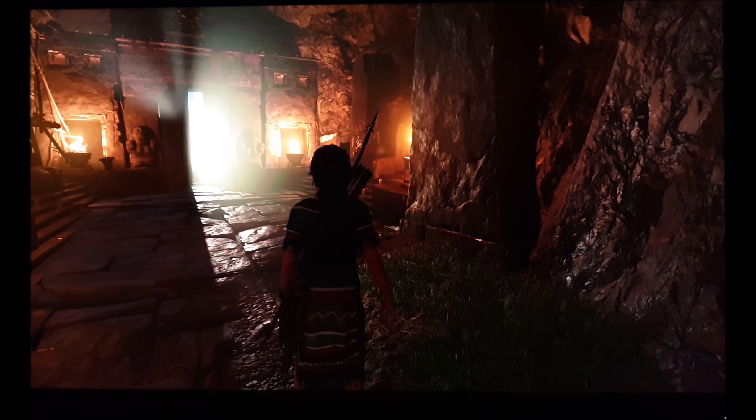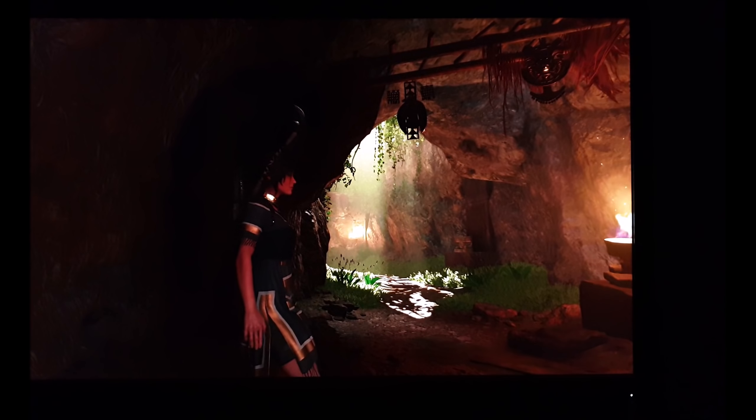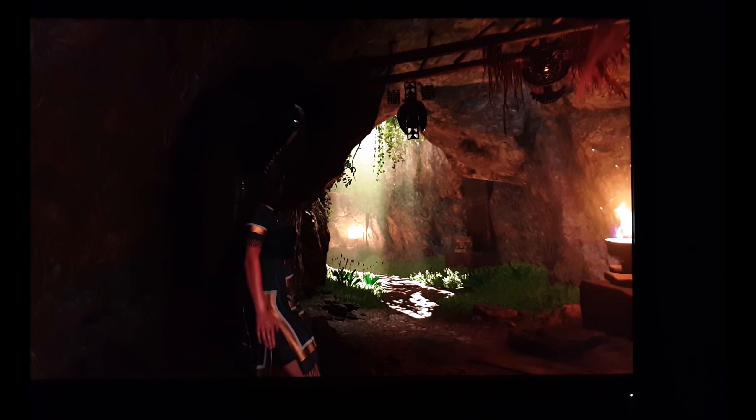If you view those elements towards the edge of the screen, or shift your position to look from an off-angle or more extreme angle, you can kind of see the detail levels change. Being a VA panel, it does have a bit of VA glow — most noticeable towards the corners of the screen — but there's actually a very small amount of that on this model. Even in much darker scenes you can kind of see it if you're sitting in a dark room, but it's not extreme. Comparing it to IPS glow, it's really very subtle. I've certainly seen more of this on some VA models of this kind of size, particularly the curved models. So this model doesn't really have a problem with VA glow.